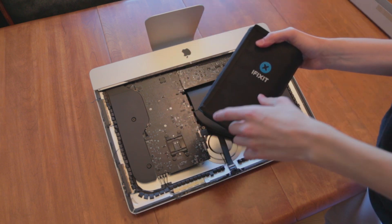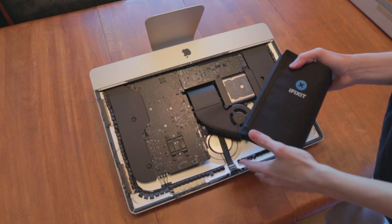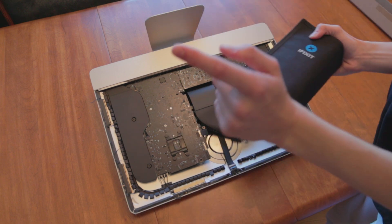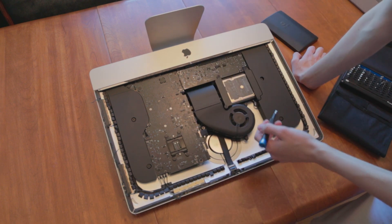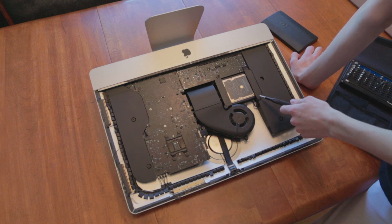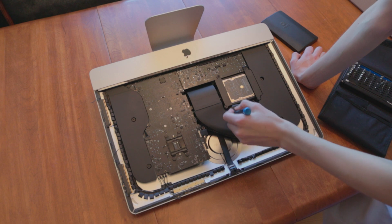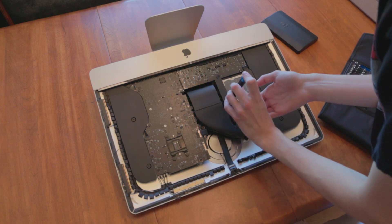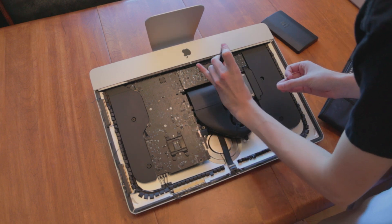If you're getting tools to repair stuff like this, iFixit is the way to go. They have some of the best tools on the market. I've had this kit for like two or three years and it has never let me down once. I have everything I'll ever need to repair anything like this — I've even done things on my car with this kit. Not sponsored, but I'll link it down below because it is the best on the market right now. Because Apple likes to be a pain sometimes — and by sometimes I mean all of the time — these two screws are the only two screws in this entire set of four that are the same length. Whenever you're doing things, be mindful of these and don't mix them. If you put a long screw in a short hole, you are going to cause damage.